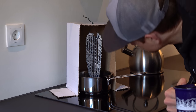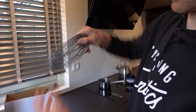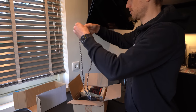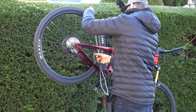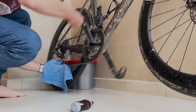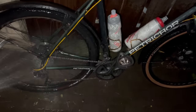The next morning it's time to check out the chain after it's been drying all night. Once cooled down you'll need to break the chain by moving all the links around before mounting it — you'll notice it's very stiff because all the wax is solid between the links. As you move it, some particles will fall off and the chain will become more flexible. Do it above a bin or outside or you're going to create a mess. Once mounted and you start rotating or riding, within a minute the chain becomes super smooth. Step 3: re-waxing. You can do it with drip wax or hot wax — and like I said, you don't need to clean your chain. Just use a dry rag before applying, or rinse the bike and chain with water or a little bit of soap, and your chain will be super clean.